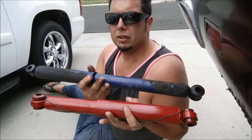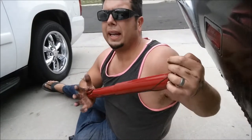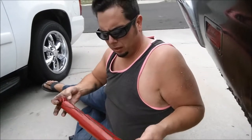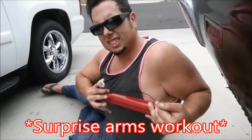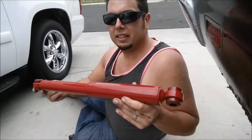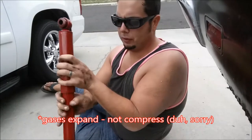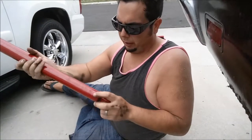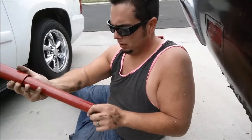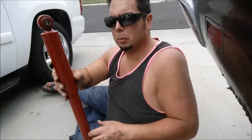Here's the old one fully expanded and here's the new one — it's tighter. When you put it on the top bolt, you can just one-hand squish it or compress it. New shocks come with a cheap wire clip holding them compressed just to save space — work those biceps and once you compress it, it just falls right off, so don't think you have to unwind it. It'll keep expanding as the gases decompress for the first time since the factory. Make sure the dust jacket — the larger part — goes on top so dust stays out, like an umbrella.